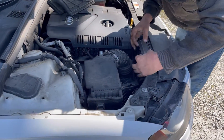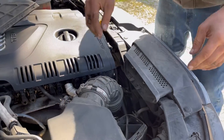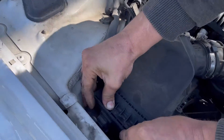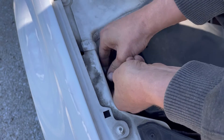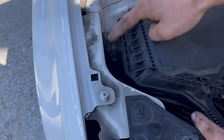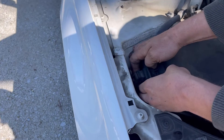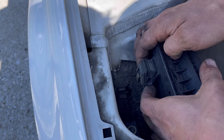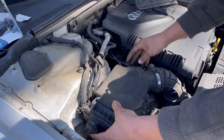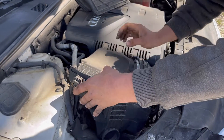These tabs are still all here, but it's a little bit loose inside there. This grommet right here — I had already pulled it out, but I'm going to go ahead and put it back in and pull it out again so you can see. You can break this plastic right here if you're not careful. So I like to put my fingers down in here and then pull out the grommet like that. And then you don't even need to unplug this or disconnect this hose — just kind of pull this up out of the way right here.